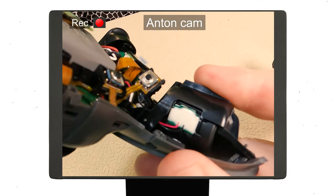Once you get it lifted, the SCUF battery does just slide out. Comparing battery to battery — absolutely identical. This is a PlayStation 5 battery, and so is this. In fact, they're both made in the same place and have the same specs. Does this battery tray come out? Again, one screw. And keep in mind, all these buttons are attached to this battery tray. That is a rat's nest of cables — obviously the battery tray in the PlayStation 5 controller is designed to come out cleanly, but this one is a mess of wires in there.